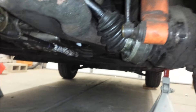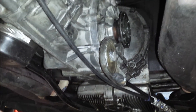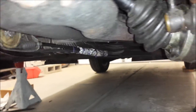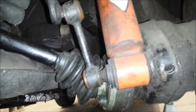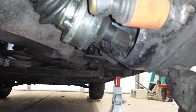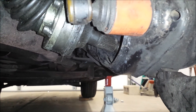In the last video, we did the driver's side rear axle bearing. I'm going to show you how we go a little more in depth on this one. You can see the transmission and we've removed the constant velocity joint — it's still on the axle, propped up over the exhaust system. We were able to remove the rotor and we've got the hub exposed. We drove out the drive hub, which is the short axle, still attached to the constant velocity joint. We didn't have to take this CV joint loose inside the hub — we're going to slip that back in when we're done.